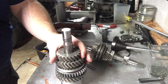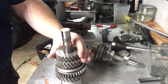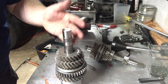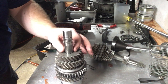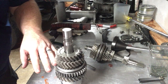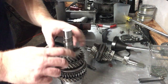When looking at the clip for third gear, the book on early type one stuff specifies that you can have play in that clip, but that allows third gear movement to hammer. It's probably not a big deal on the 091 package setup, but on the type one setup — beetles with three-rib or five-rib transmissions — play here also gives the one-two hub play, because it's all locked together. The more drive it has, the faster it'll pop out and bash those shims. So on type one it's good to use hardened shims and get the clip in as tight as possible — you don't want it to have a running start.